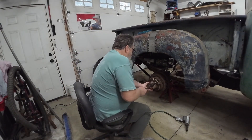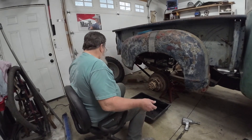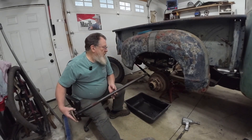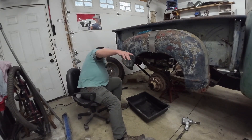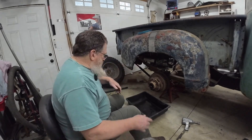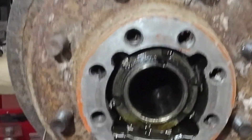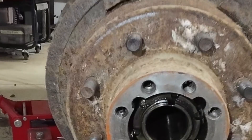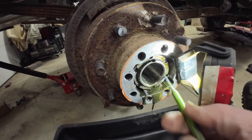And the axle — of course you make a mess right off the bat. There's our axle. Now there's a nut in here that you can see in there — there's two nuts. One's got a little ear on it that you've got to flatten out so it hits in one of these little dogs here. Then you'll see that whenever you get the little tab out of there, they'll just come loose.